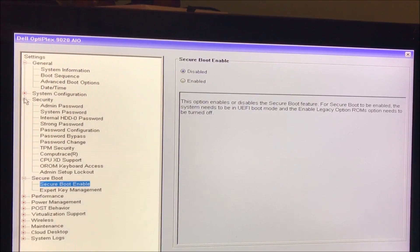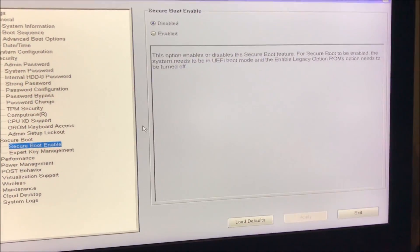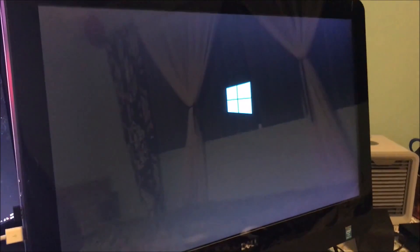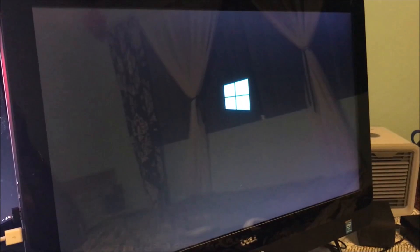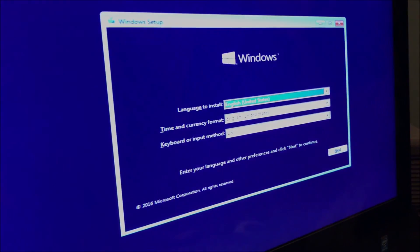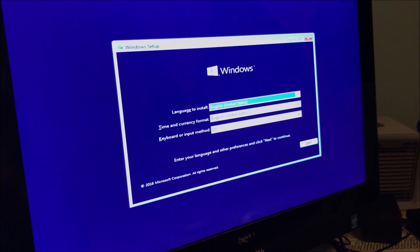Under security that's about it, then just exit. Once you exit, press F12 to boot into the boot sequence interface, choose the USB stick, and since it's a bootable flash drive you're able to start downloading your new operating system onto your new SSD.